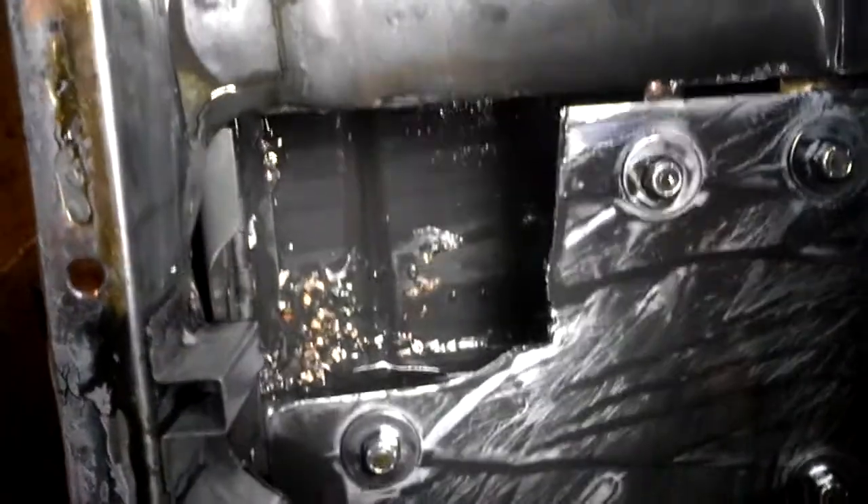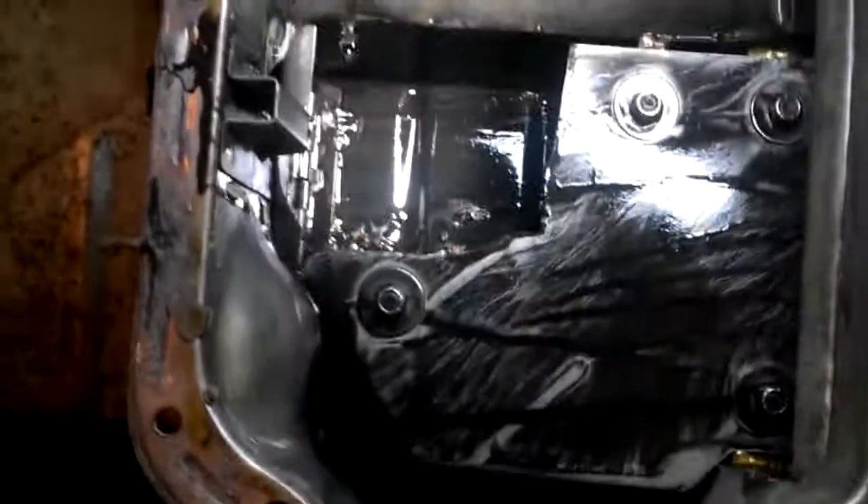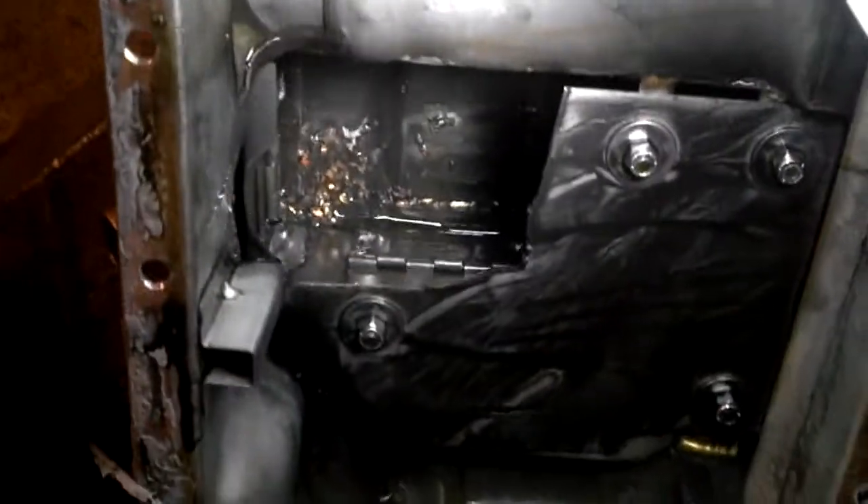There's most of my number five bearing in the bottom of the oil pan. That's not so good. It looks kind of milky and sludgy, the oil in there. So this oil pan is probably going to need a real good clean-out.